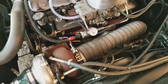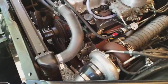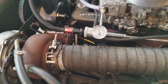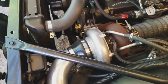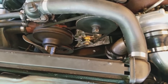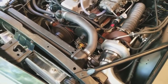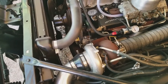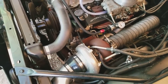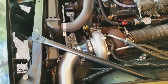No leaks that I can find, including the donut gasket — which is shocking because I'm not a big fan of that setup. I discovered throughout installing the power steering pump that the alternator post for the battery had rounded itself out, and in the process of trying to tighten it, it snapped right off. I dismantled the alternator and discovered the whole plate inside was corroded and destroyed. So I replaced it — $75 Canadian, not bad for peace of mind. Fantastically, it solved my wiring issue: I'd had problems with the headlights and the stereo cutting out — a grounding/shorting problem — and that's been resolved.